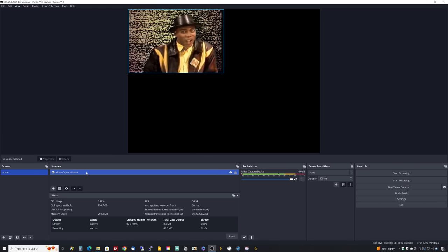As easy as that was, you might encounter some issues. If you're dropping frames because the CPU load is too high, you can shrink the captured video size. Instead of 1440x1080, you can choose 960x720. This won't look as good if you upload to YouTube, but it's always better not to drop frames. If that doesn't help, you might need to upgrade your PC — any PC made after 2010 should work without dropping frames. If you're dropping frames even though CPU load is low, this might be caused by timing issues such as old stretched-out VHS tape, poor over-the-air recording quality, recordings made at 6-hour SLP speed, or dirty VCR heads. You can clean VCR heads with a cleaning tape.